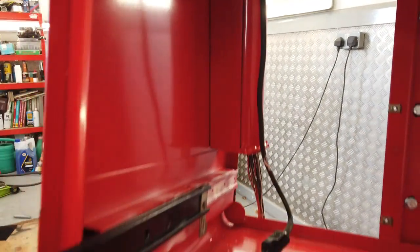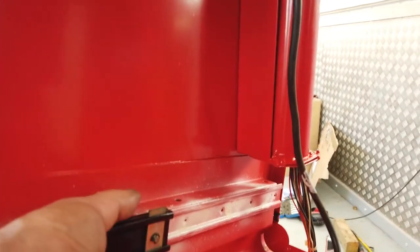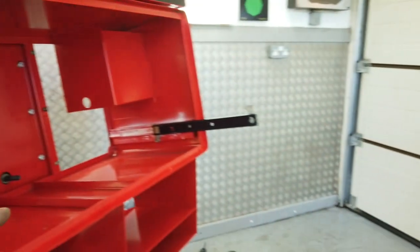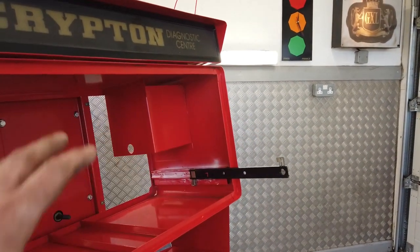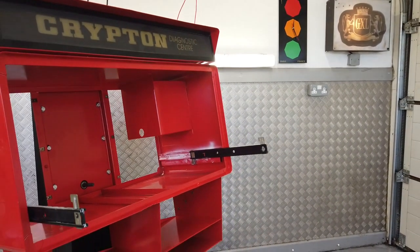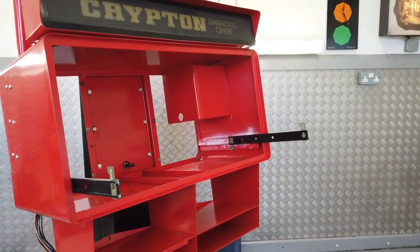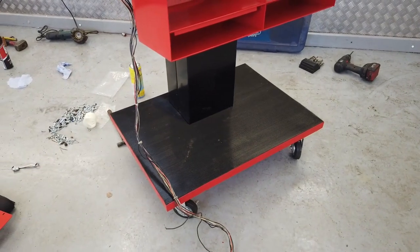It locks in to a little slot under tension with a pin there. And the idea is you draw out for servicing the chassis and it locks in place. And it's locked, then it won't keep trying to slide back as you're working on it. So that's a locking system for servicing. So earth wires on, and then I'll put you back on the tripod. We'll lift the drawer, slot it in, start connecting up the harness.